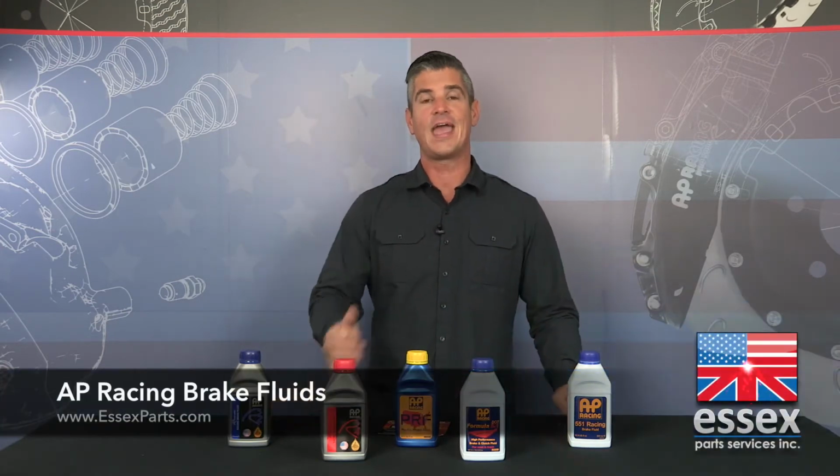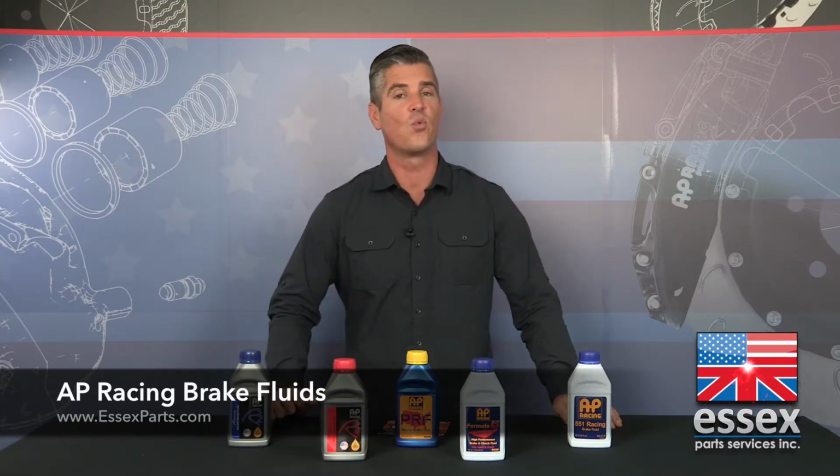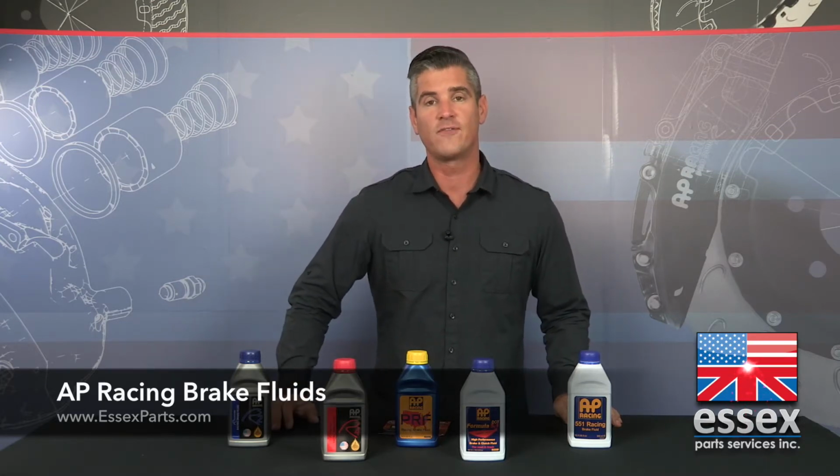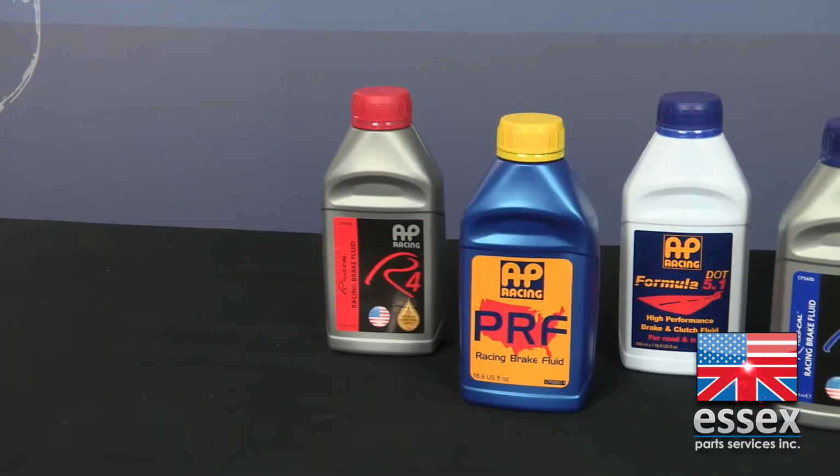Today we're talking about one of the unsung heroes of performance brake parts, and that is your brake fluid. Like every other fluid that goes into your car, it loses its effectiveness as it ages, wears down, or runs out. Brake fluid should be changed every 1 to 2 years as regular maintenance or every 30,000 miles.